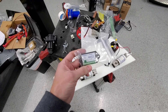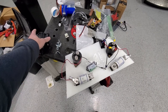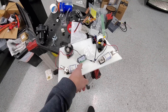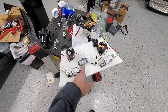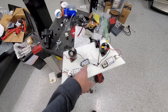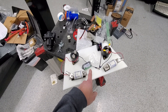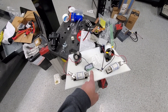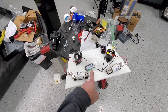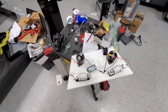I'm figuring out how to use this charging connector. When it's plugged in it's got two pins that allow everything to work — it acts like a relay so when it sees everything connected it'll allow charging. It also has a built-in relay. The main purpose I'm going to use it for is to disable drive so you can't drive while it's being charged.